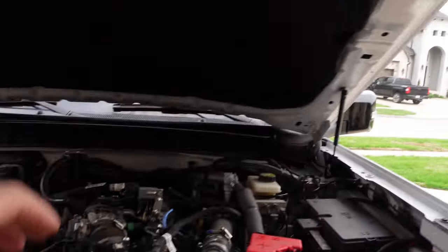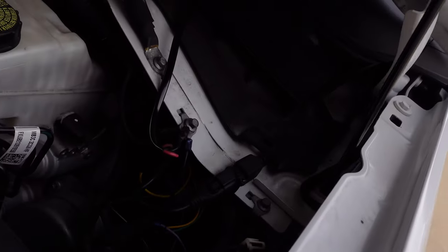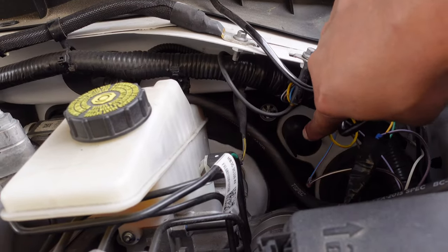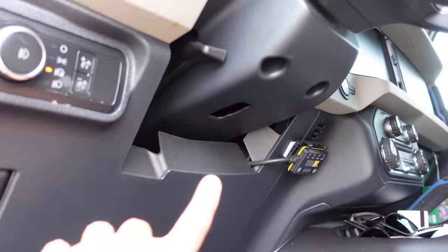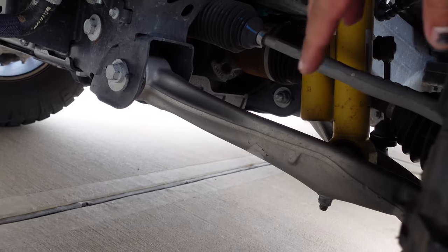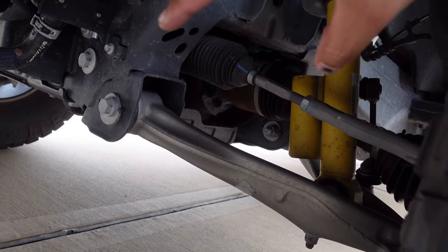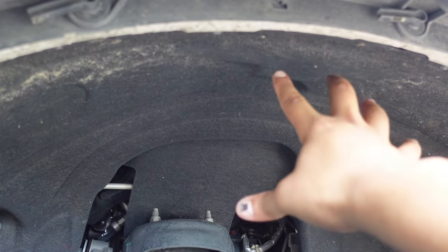Today we're just running four lights. I'm thinking about mounting the harness somewhere over here. The switch I'm going to run through a small grommet — I'll poke a hole through there and run the switch inside, then mount it on this kick panel. I want to light up the suspension more than the tire. These are usually used for off-road purposes — whenever you get stuck you can shine underneath and see what's going on with your suspension. I'm going to mount the lights on the fender liner and run the wire behind it nice and neat.